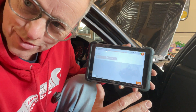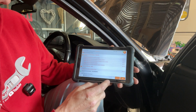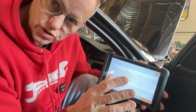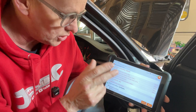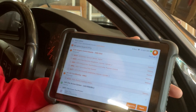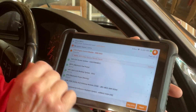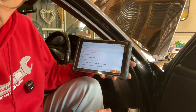Yes! Finally we've got rid of the code that's been there for all those years. So the new sensor's fitted — happy days. These are all historical ones. The brake vacuum sensor is another one on the list. I did change that at some point but it was a cheap non-genuine sensor, and now I've got a branded sensor so we're going to pop that in shortly — watch this space. Back in here we can clear the DTCs and see if there's anything relevant. The only thing that is relevant now is that vacuum sensor, which we can change. Other than that, that's not a bad result.